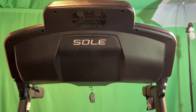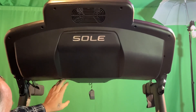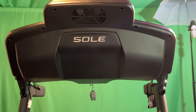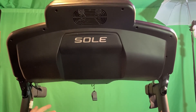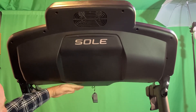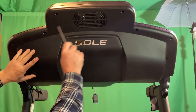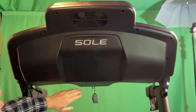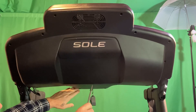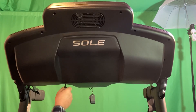We're going to change the display. The first thing we need to do is unplug it. The console back actually has a lot of screws — you'll see a lot of different holes in here. I've removed some of them and I'm going to explain the order in which I do it. I always remove the lower half of these screws first because I want this to hang down and have the upper half still connected to support the weight. If you work on the upper half first and it's hanging, it gets completely in your way.